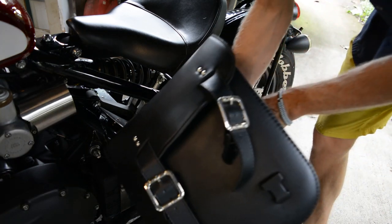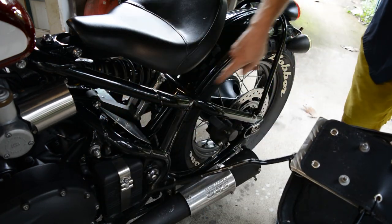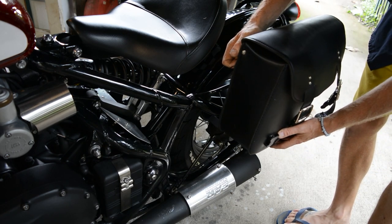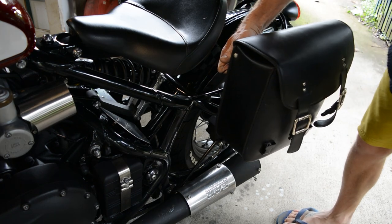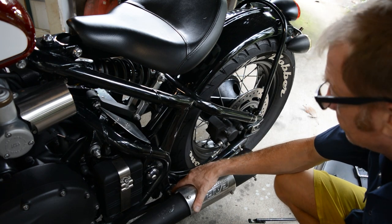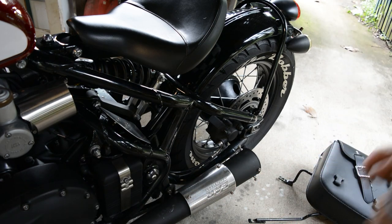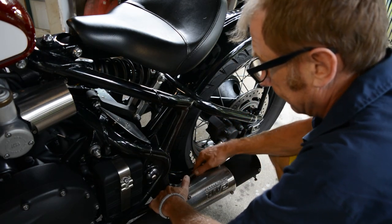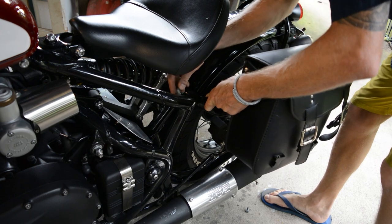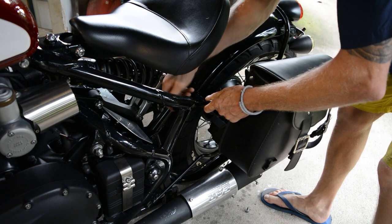So what I've got here is one of my bags — I made these, just bent up this bar work a while back. They sort of go like that, and the bags fit on just like the original ones they charge you like 190 dollars for. They fit there like that, and then my rack's going to go here. It's a little bit of a pain in the bum — it doesn't take long, it's just this 12 mil bolt here that's awkward to get to behind the exhaust. It's all right when the bag's not there but once you've got the bag, it's not very easy to get to. I use the original threaded bolt holes in the frame behind the eyelet — they're very handy.